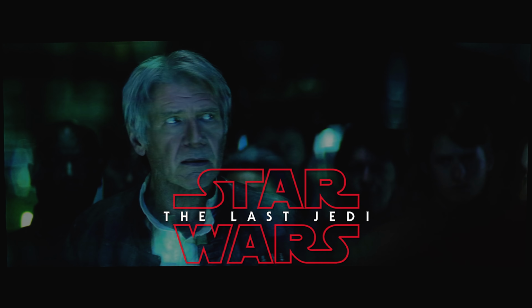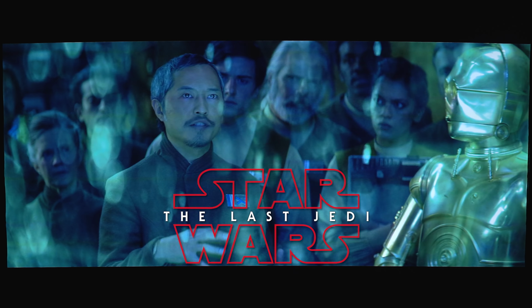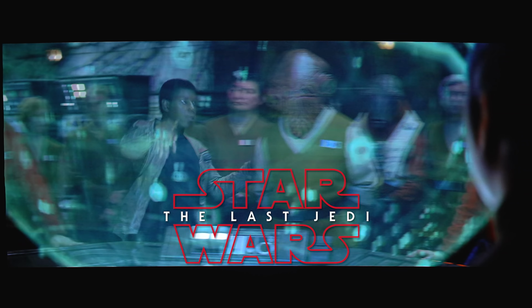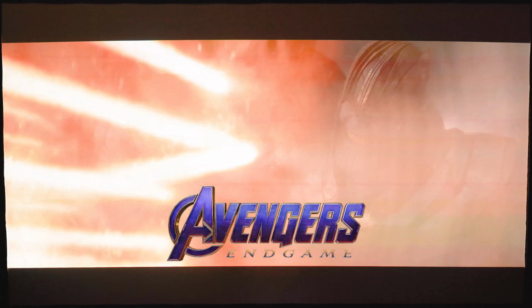The only real issue that I had was with the dynamic black level settings. Settings 2 and 3 are totally unusable, although setting 1 does a good job, but the color does do some funny things when it's active. As for black levels, I found it perfectly fine.